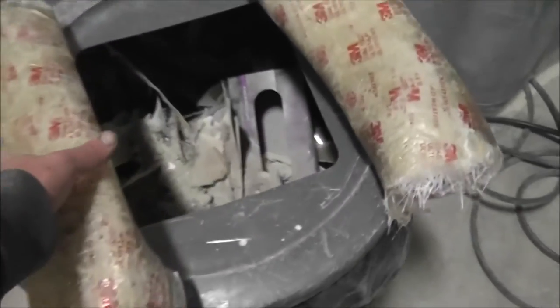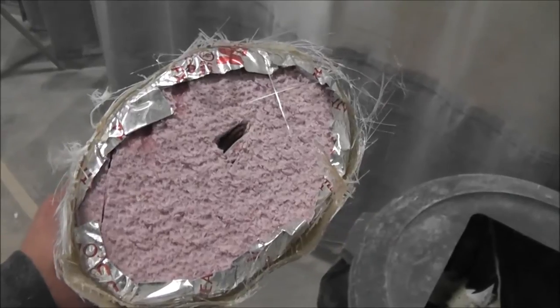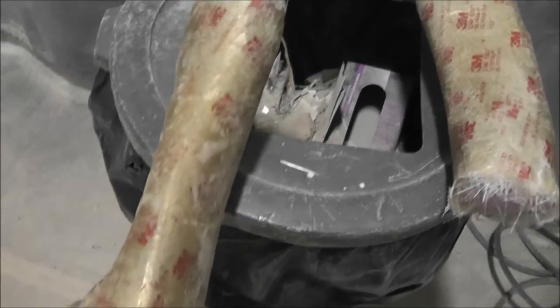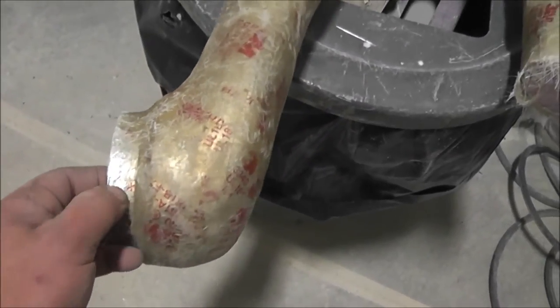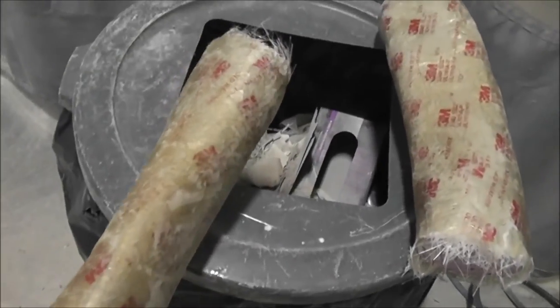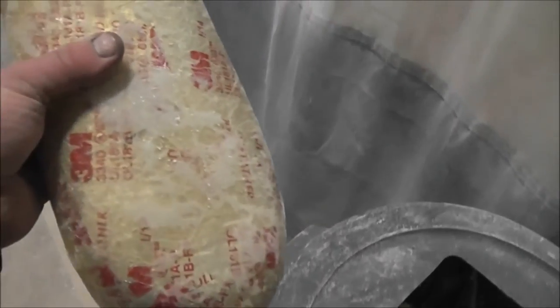Here's another way to use that pink foam. You can see that's just the pink insulating foam you get at the hardware store for your walls and stuff — just different layers glued together, make it thick enough, and shape it. This end is a fiberglass ring that we made and attached to the foam. This is for the air box — this end will go in the air box and clamp, and the other end will go into the scoop on the quarter glass. Just put aluminum tape over the foam to protect it from the fiberglass, wax the tape, and then lay fiberglass over it.